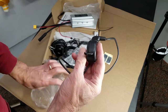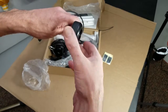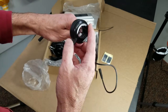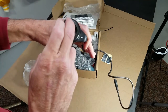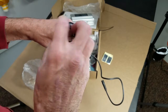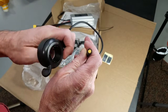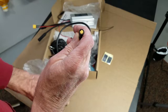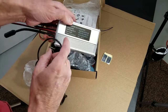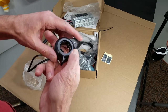Here's what they look like. It mounts on your handlebars, and usually this wire will be going towards the center. So this is a right-hand throttle. It's a variable switch with something called a hall sensor inside. Think of a magnet with a sensor — it can sense how close that magnet is to the sensor. From there, it takes an electrical signal over to our controller, and that controller will convert that signal into variable power. That's how the throttle works.